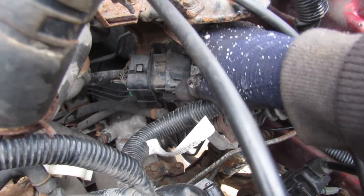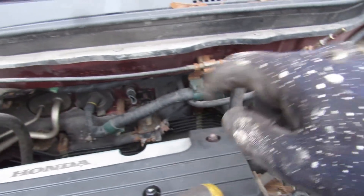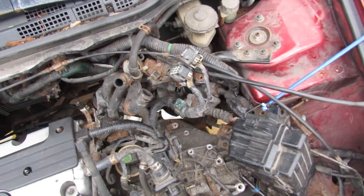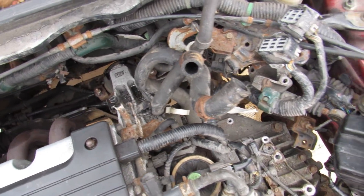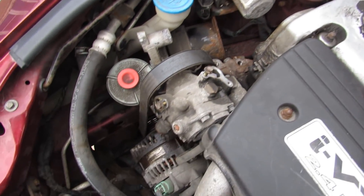It's pretty cool that Honda uses these connectors to disconnect the wiring harness with the engine, so it's easy to swap instead of going inside and disconnecting the computer. Once you've made sure that all the hoses and wires have been disconnected from the engine, we're pretty much free to strap it up to the crane.